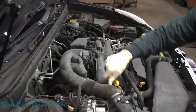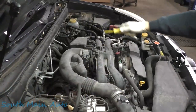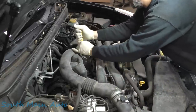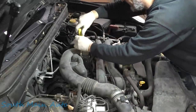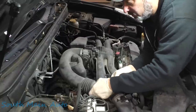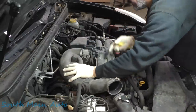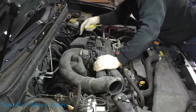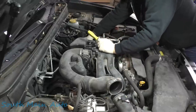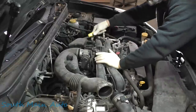We're going to pull the air intake tube off here. We need to be able to stick an engine support across these struts here and hold the engine up, because we need to suspend the engine while we remove the cradle. I think we can hook onto it back here at the back of the transmission. Let's see, we've got a hose down on this side. Part of the PCV will unhook it. And then we've got a clip right here.